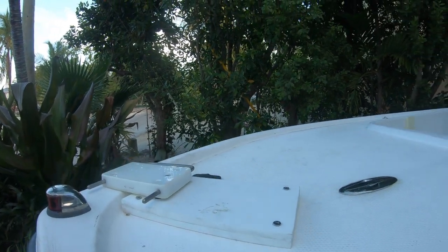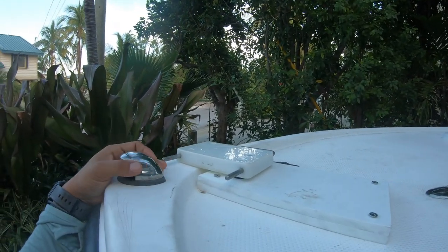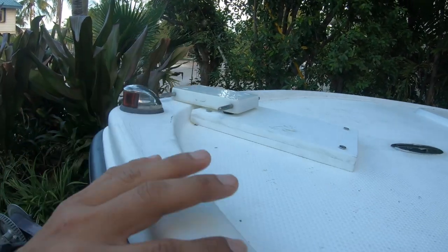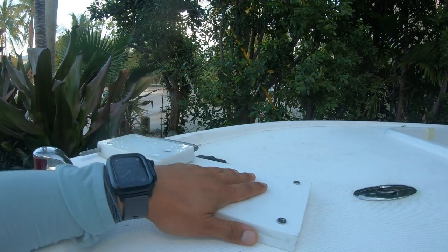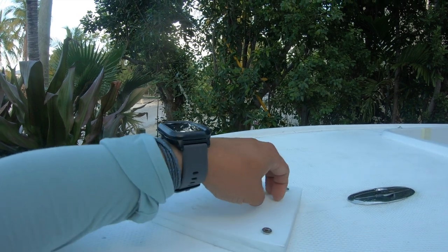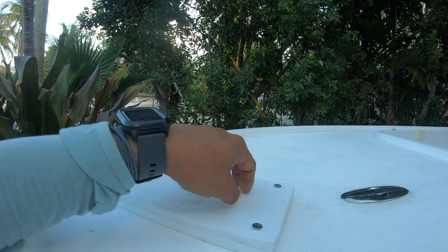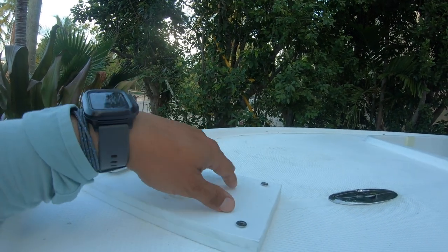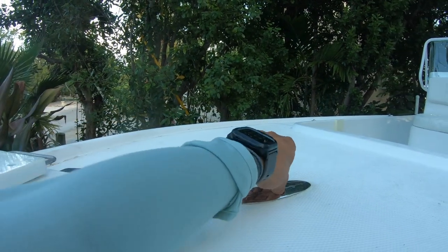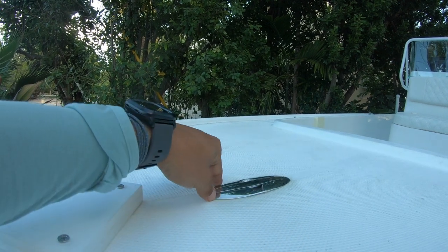Taking you here on the bow. We removed the light to mount this puck, removed some rope guides we had in the front, filled them in with some marine-tex. I had to assemble a piece of starboard and remove a through-hole cleat that I had here in the front — it was run down to the stringers. It's too heavy to lift this boat, and this boat's only 17 feet so it's not really needed. I installed a pop-up cleat, flush mount, so that when you fish on the deck it's safe.